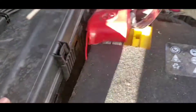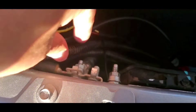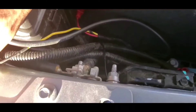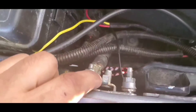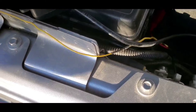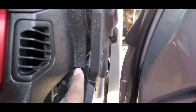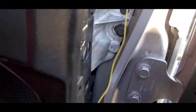So we've got the module wired up to the power — you can see that's where we got the power, ran the fuse through there. What's nice about this is they put these ground spots on the Jeep. The JL and the Gladiator will have these nice ground spots so you don't have to fight to find a spot to ground it. This one was actually by itself, so I just grounded it to here. This yellow wire runs inside through here — we ran it through there and brought it through here, so you can see it comes through back there. Now we're just going to go down here and tap into that, and that will be the entire part of this whole assembly.